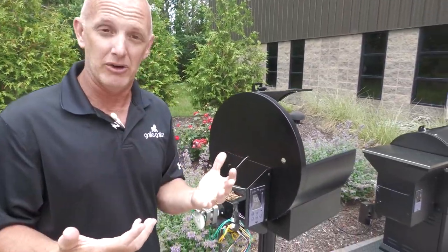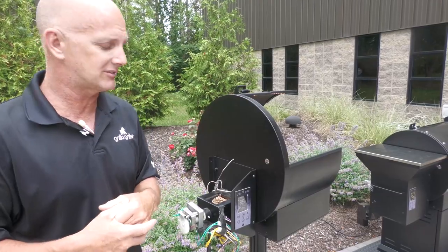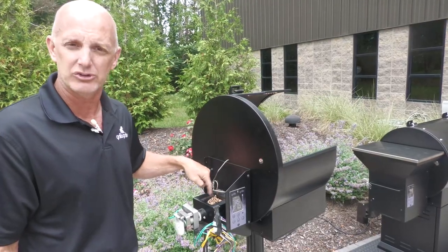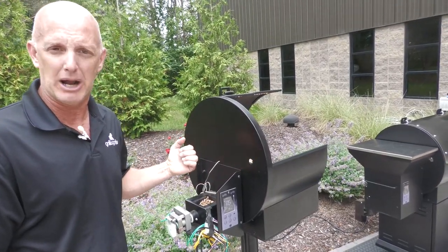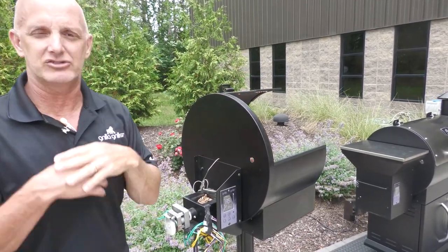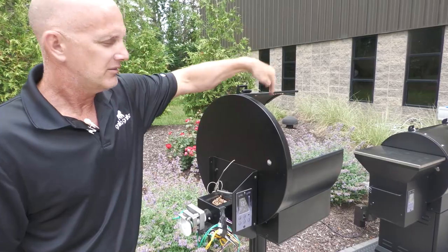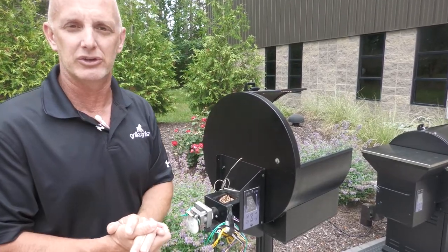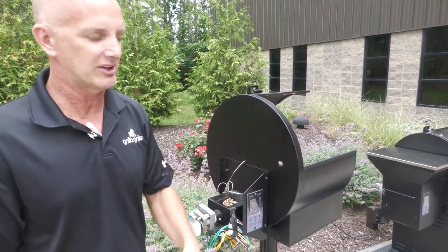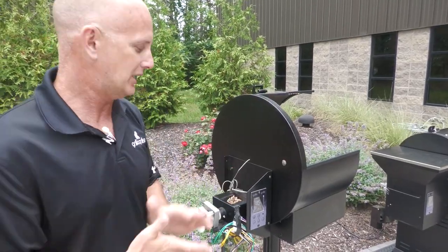The next thing you want to make sure is that you've got clean fuel. In the area where your hopper is, a lot of these bags — even though they could be good brands of pellets — these big box stores handle them a lot, and they can actually break them down, or they could be sitting outside for a long time. So when you're pouring that bag of pellets and if you see a lot of dust coming out, stop — because that sawdust will build up and it'll start choking out your auger and not allowing proper feed. Four to five cooks clean out the burn pot. Four to five bags, vacuum the hopper out, vacuum the burn pot, get a fresh start. My Silverback's been on my deck for almost six years and I've never had any issues. Clean hopper, clean burn pot, good fuel — it works great.